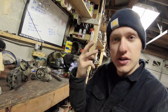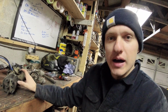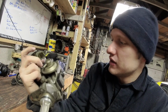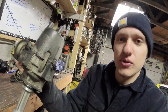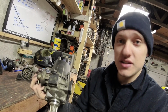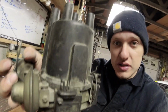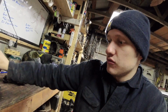Now, the third distributor. Okay, before we get to the advances. Third distributor, the most common. Your late model electronic ignition distributor with the J109 igniters mounted on the distributor. This is by far the most sought after, common, super easy to use distributor setup on a rotary engine. It takes 3 wires to make this work. You use the standard resistorless ignition coil and you're good to go. It's literally easy peasy.